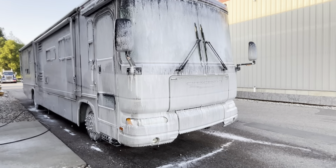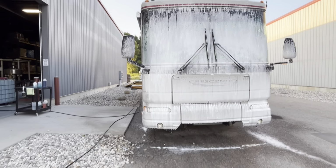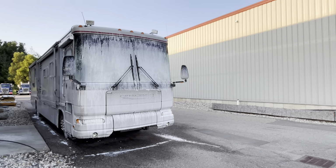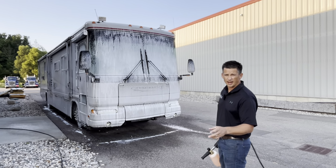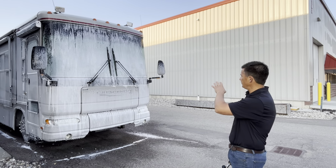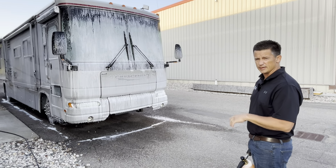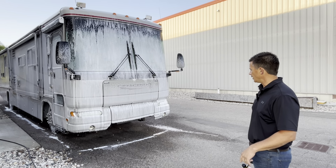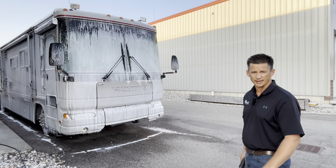That's the number one. So now we're gonna be putting on number two. Typically what you wanna do is, when you foam on the one, by the time you see how long that took, maybe 15, 20 seconds, I can put my number two on it right over top. If you're doing like a car, sometimes you can do the whole thing. The longer it's on there, the better, but you gotta understand too that you don't want it to dry. So you gotta find that happy medium.